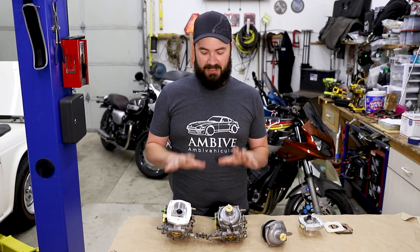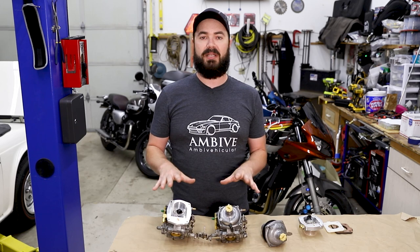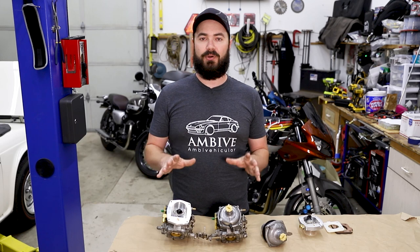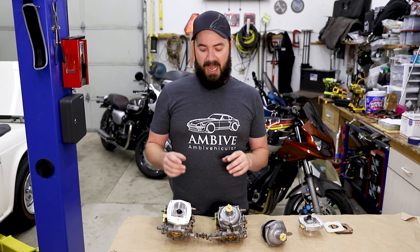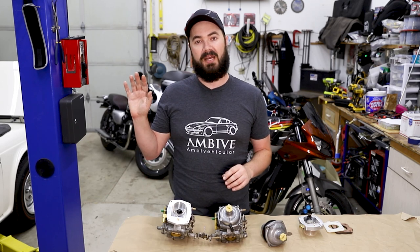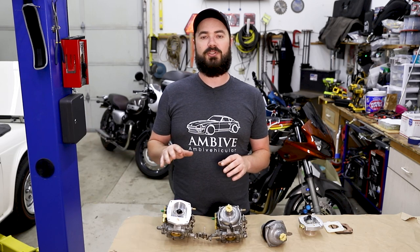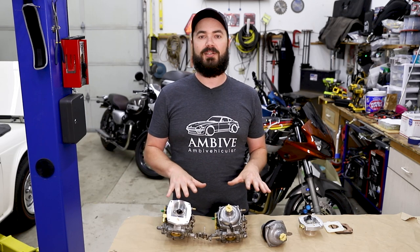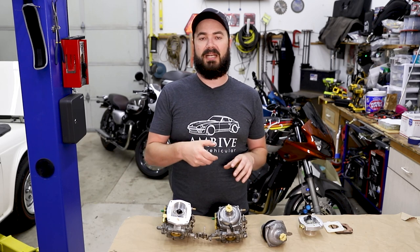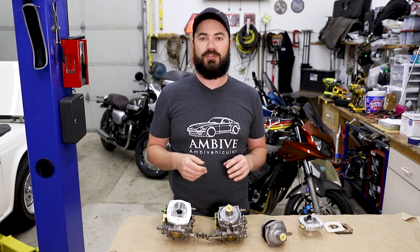The biggest hassles in the installation of this kit will definitely be the running of the wiring and the plumbing of the fuel system. There are a few things that will be very different in my installation than yours if you do this at home. I'm going to be doing a PMU-16 to control all the power, so I'm doing a lot of rewiring of the engine bay, deleting the factory fuse block, and cutting the wiring harness for the fuel system and replacing it with an autosport connector to go through the firewall rather than just shoving the wiring harness through a large grommet hole.